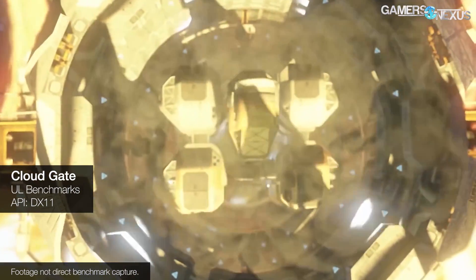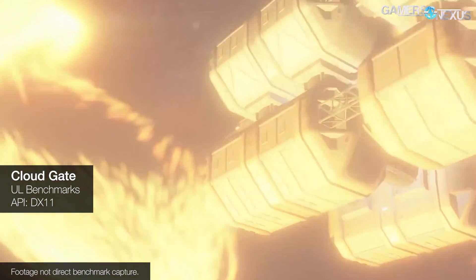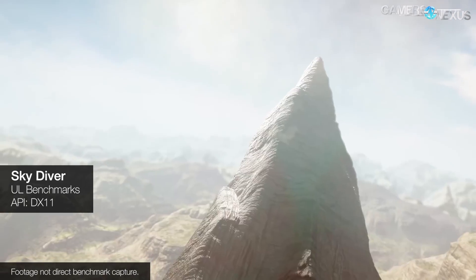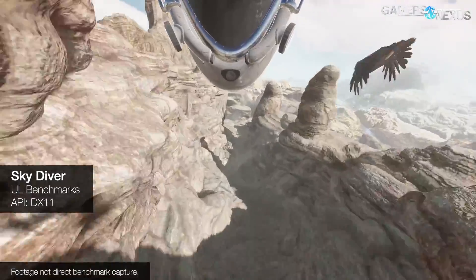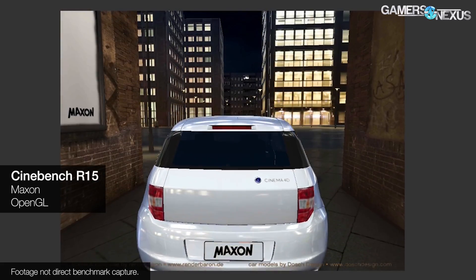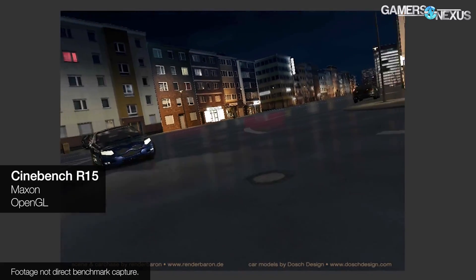We tried to keep the benchmarks semi-modern while staying within the hardware capabilities, but the PCI cards are not DX11 capable and had plenty of difficulty just launching Windows 10. We used 3DMark's Cloud Gate and Sky Diver benchmarks primarily, with Cinebench R15's OpenGL test for extra testing, Unigine Heaven, and Metro: Last Light as a game test. Tests were run at 720p because Patrick's 512 MB HD 5450 didn't seem to like running 1080p in CrossFire, and he wanted CrossFire as an advantage. The GPUs were still the bottleneck at that resolution.